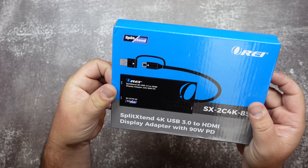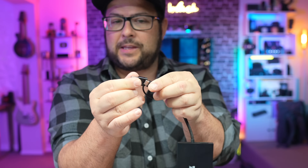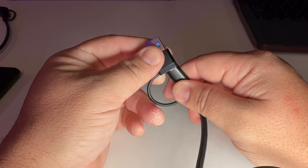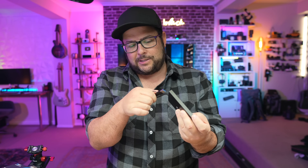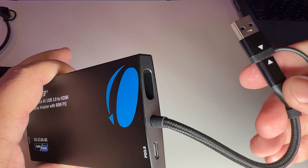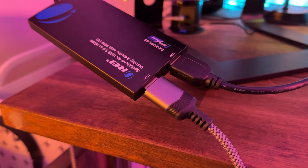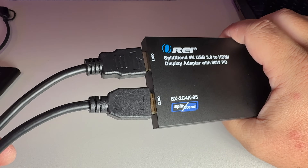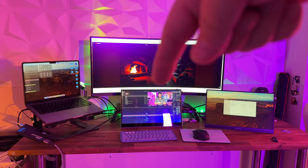Let's get a little bit more complex. This one gives you two outputs and you plug it in with USB-C, but it also comes with a USB-C to USB-A adapter in case you don't have a USB-C port. It also has PD 3.0 for charging, and there's a little spot where you can tuck the adapter in for traveling. This one is a little more powerful and you do have to download the drivers, but you can get 4K 60Hz or even ultra widescreen 4K. You can connect up to eight monitors on Windows and six on Mac using multiple hubs.